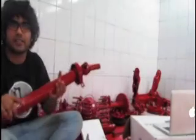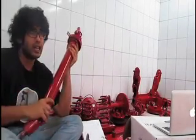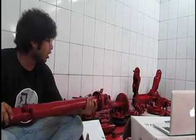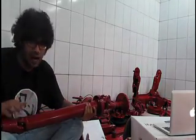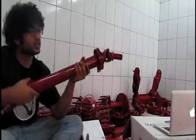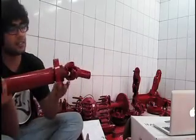Now, as we cut the chassis of the Contessa from the center by 7 inches, we made it shorter from the original size. We had to do a lot of alterations on a lot of parts in the undercarriage to match our body specifications. So this is the propeller shaft, we cut it 7 inches from the center.